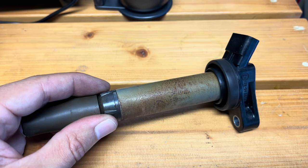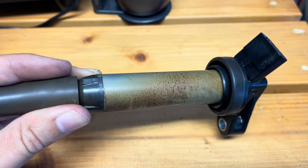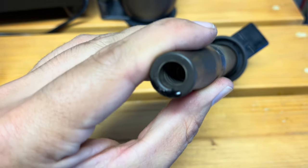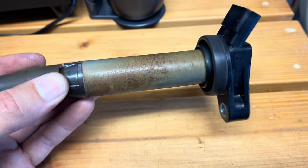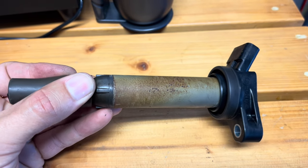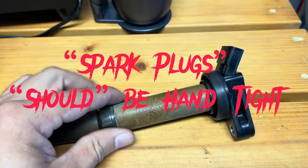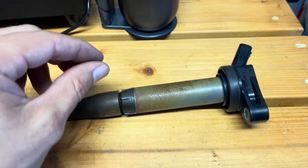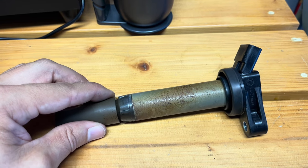This was the second ignition coil that Jason pulled out where we noticed this issue. Our thoughts are that potentially the spark plug was loose from the factory and there was some blow-by happening from the spark plug not being tightened all the way. I'll put down in the description some articles I found on Tacoma World of people having similar issues with their newer Tacomas. These are supposed to be hand-tightened, but that can mean a lot of things — are they twisting it with a socket extension or actually tightening it with a ratchet until it's considered hand tight?